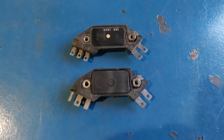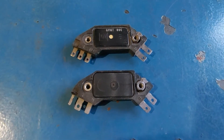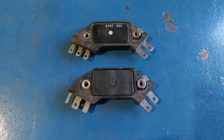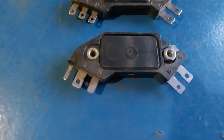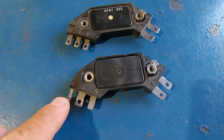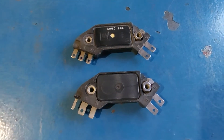The next two modules I'm about to talk about are the GM 5-pin modules. But you do not want to confuse these two ignition modules — they operate very differently. You can see one of them has a thin little R pin, and this one has basically three pins the same size. So you do not want to confuse them.